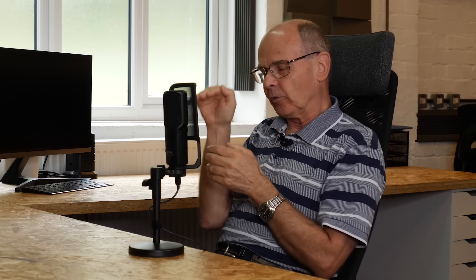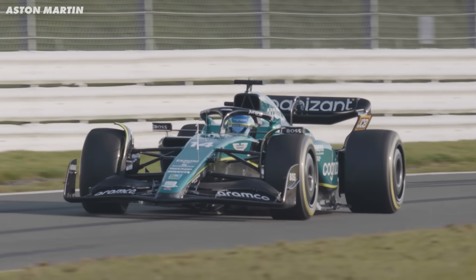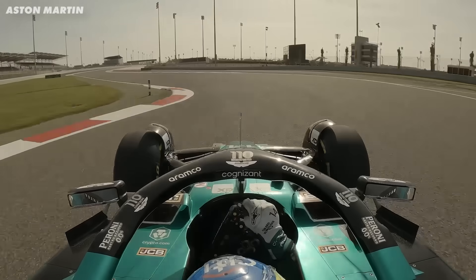The car will also be accelerating and decelerating while going over bumps in the tunnel, changing the ride heights and decreasing downforce once again. And of course this event will be outside in changeable wind conditions. You would have to have a force of at least twice the mass of the car in aerodynamic downforce, so that you get the equivalent of the car trundling along the ground in terms of grip. And this is where things get tricky for an 800-kilogram Formula One car — and that's not even to mention the engine issue.